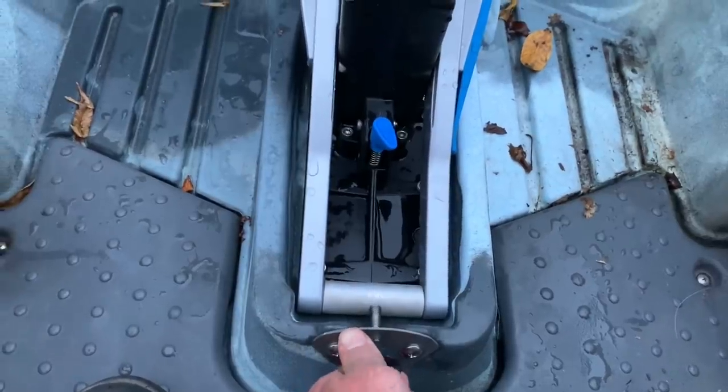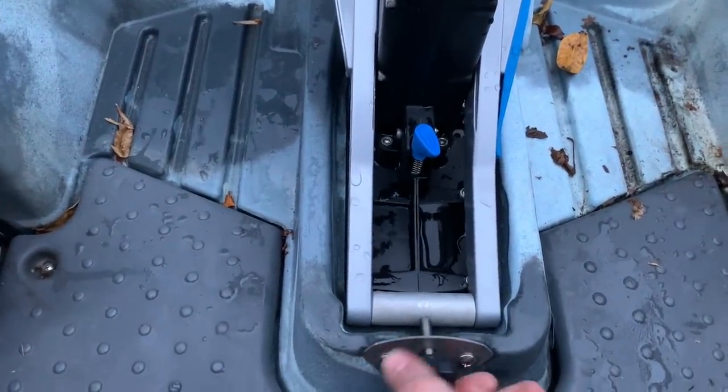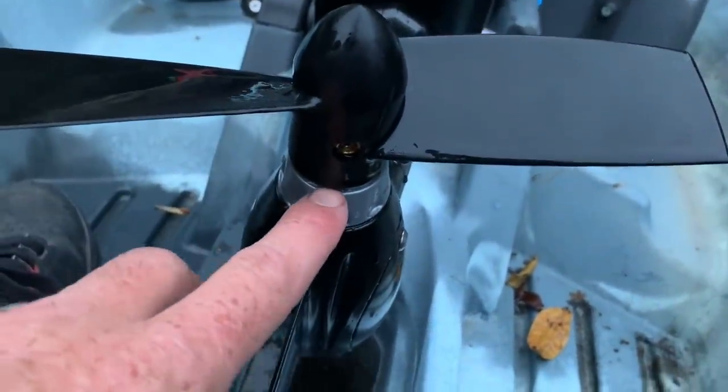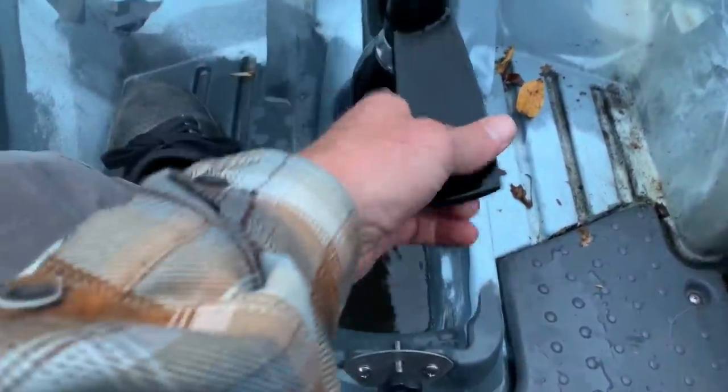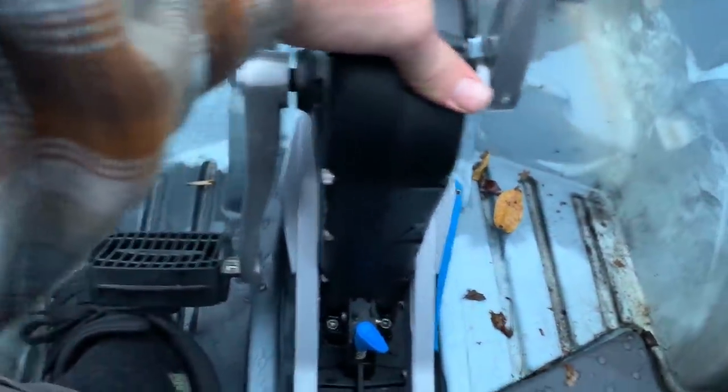I didn't show you guys how all this works — this is the release mechanism here. This is the little pinch bolt that holds it all in. Then you've got your prop indexer — pedal till the prop hits and flip this. YouTube for the win! That comes up. The nice thing about that: if you get weeds or something caught in there, it's really easy to grab and pull out. It has a fairly tight tolerance so you shouldn't be getting weeds wrapped around your prop too much. Definitely a slick setup. When you want to lower back down — simple as that — you drop it back in the water, pop that in, tighten that down, then flip this lever and that locks the drive in super solid to the boat.